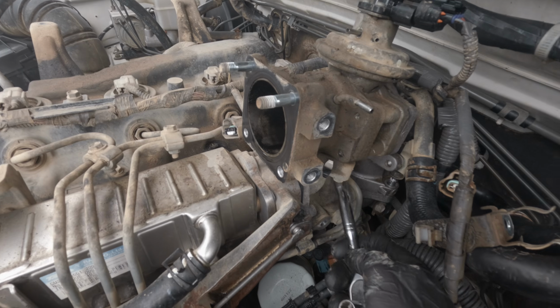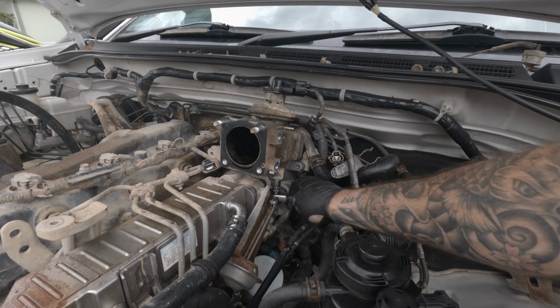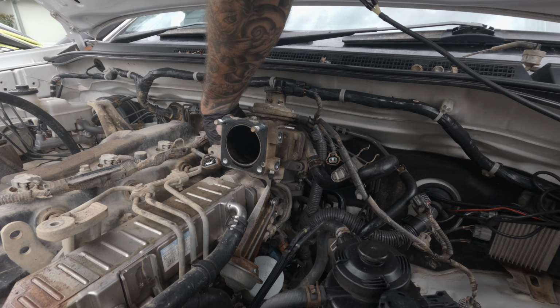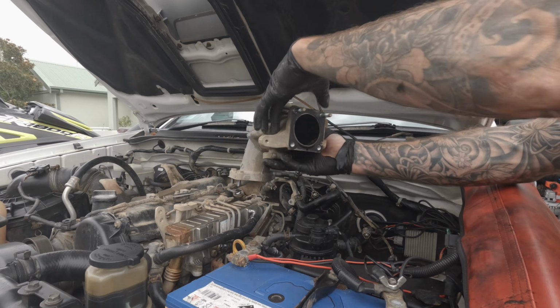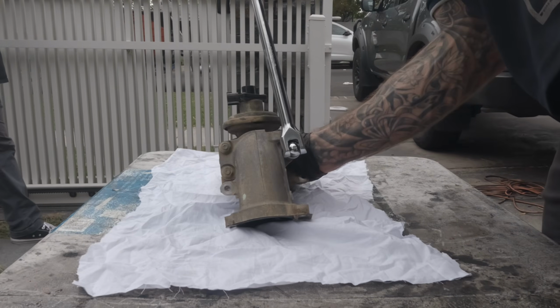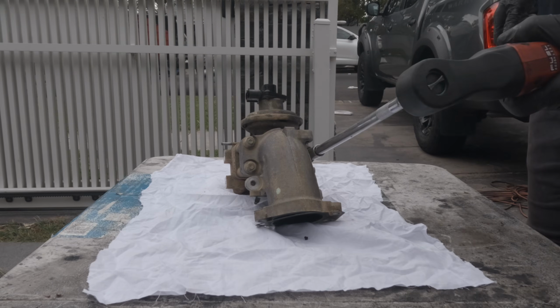These 2 bolts can be tricky for your first time. Using a 10mm socket, loosen them and do the rest by hand. Now you can remove the EGR and associated attachments. These nuts are usually always very tight. Use a breaker bar with a 12mm socket to remove them.